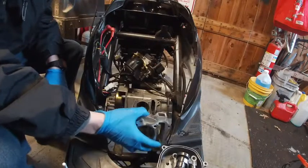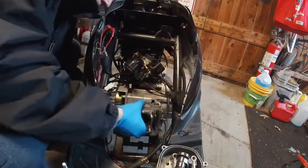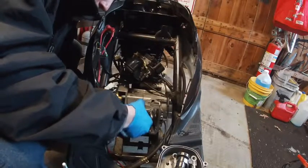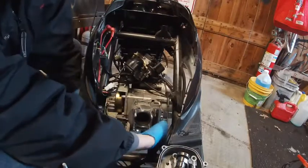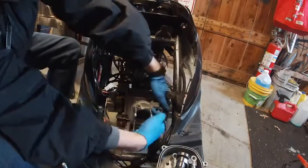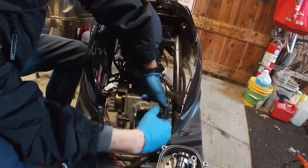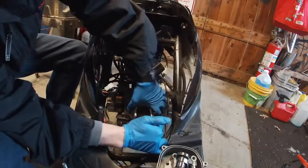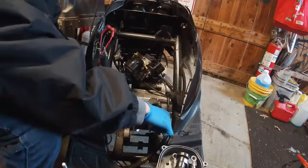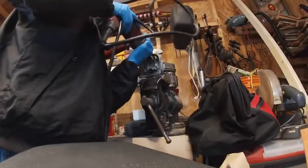The cylinder isn't quite as easy to put on as a two-stroke. Basically you want to start the open end of the top ring and push that ring with your fingernail to get it past, then the same with the second — lots of wiggling and jiggling. There are ring compressors you can buy but I don't find them all that useful. On bigger displacement motors like a 150 or 170 where the rings are pretty stout you kind of need it, but on something small that's been run before, it can be done by hand.